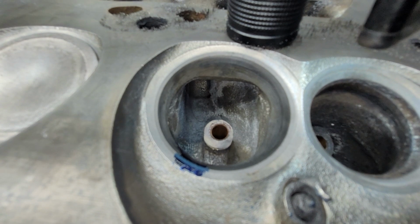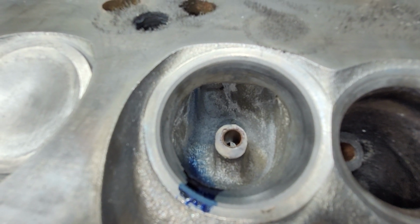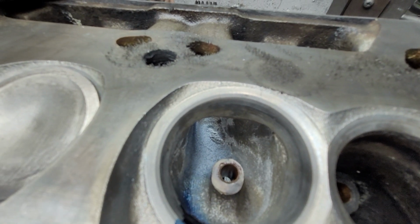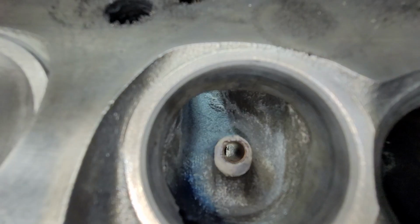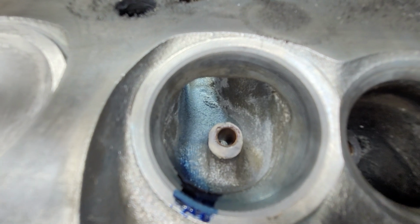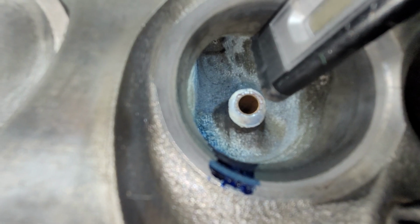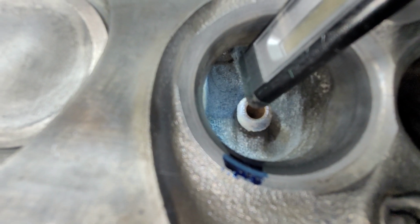and I didn't even show you this view. Let's get some different light on this. Okay, not the best with the lighting. Let's see if I can use two hands to give you some light, because I'm not having any luck, really. But notice how thin that port is, and then it really fans out for that short side radius. Really neck down, and then comes into that wide bowl. You know what else it doesn't have? It doesn't have that bump on the straight wall roof. That's gone. Oh, that makes sense too, doesn't it?